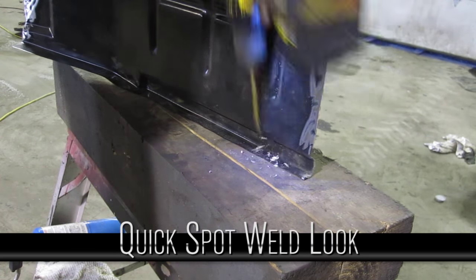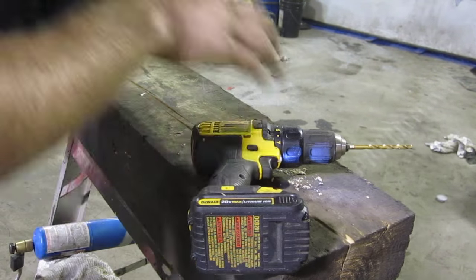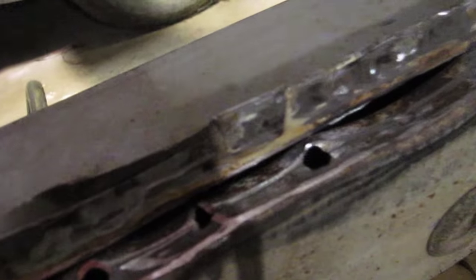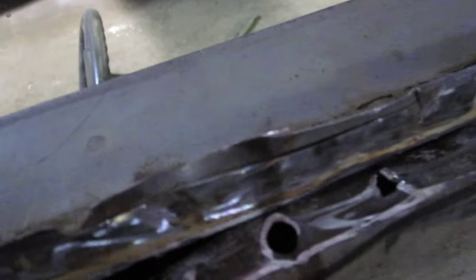Drilling the holes on a block of wood with a quarter-inch bit allows you to just hit it with the welder and make it look like a spot weld without getting in behind it — the wood keeps the steel from peening over at the back, so no grinding. For the floor, I take those dull flapper wheels and take the paint off around the outside. You want to make sure you don't see many sparks — if you do, you're taking steel off. On the sides I drilled the holes and I'll spot weld it to the side where it's ground. Where it was spot welded to the inner rocker, I'll fill those with seam sealer and spot weld to the lip instead — nobody will know the difference, it'll be just as strong, and I don't have to weld all those holes full.